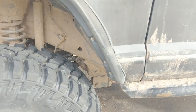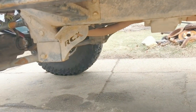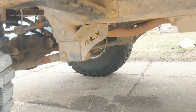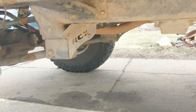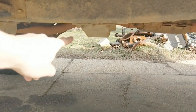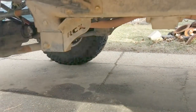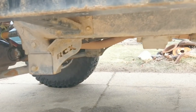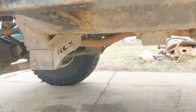I'm really looking for on-road performance, but I'm sure the off-road stuff might improve too. A lot of people say long arms ride better. For control arm angles, you might not get much better with long arms — when it's mounted higher on the frame it's got a longer arc to travel, which means injecting a little more road vibration into the body. But the extra strength and rigidity should be worth it.